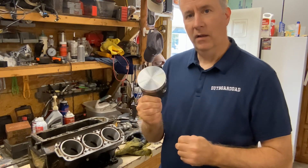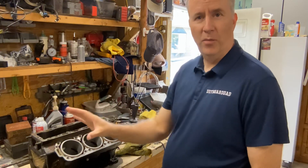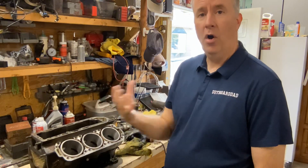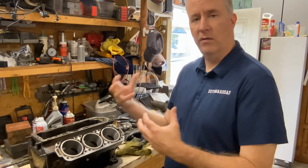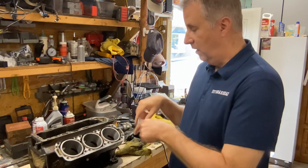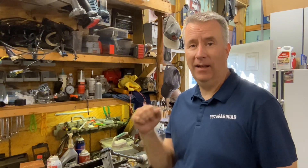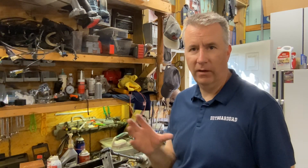Now that we've double checked our piston sizes, I'm going to do some more boring to get us a little closer. I don't want to get closer than maybe 2 thousandths over my piston size — then I'm going to hone the rest of the way. I still have some deep scratches in there, but my 200 and my 300 stones are going to get me the rest of the way. We're continuing with our machining process by hand using a Sunnen AN11 hone, getting closer to that piston wall clearance each time we bore a little more.